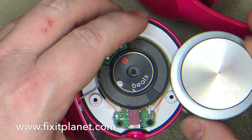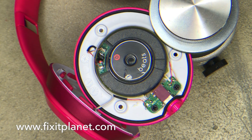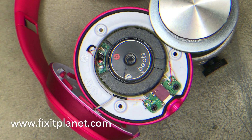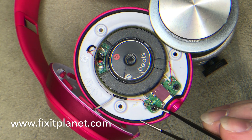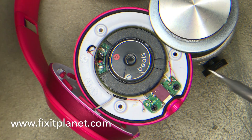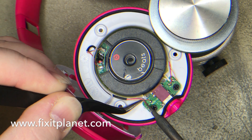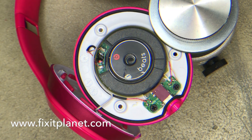So we're just going to put a little flux on there and re-solder that wire back and these headphones will be as good as new. It's pretty common for pretty much all the Beats models to have pretty crappy soldering and wires that get pinched, short out, or solder joints come loose. We're just going to take a little excess flux off of there — we don't need all that flux. Now we've got a good solid solder joint on there.